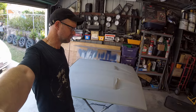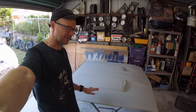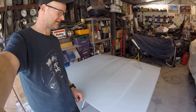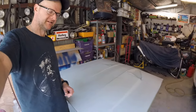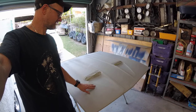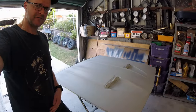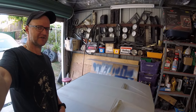After many attempts to lay down some primer with my 20-year-old spray gun, it's finally got to the point where I can say it's satisfactory. It's got a bit of orange peel in it and the last couple of coats were pretty sketchy — boy has this bonnet got some character dents in it. What I'm going to do now is gently sand it with 400 grit, wait until the morning, and throw some Neptune blue down on it, hopefully before I go to work. I really need to retire that spray gun I've had for 20 years. Maybe this is that last job.